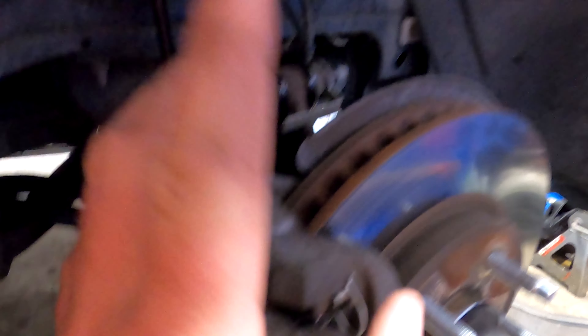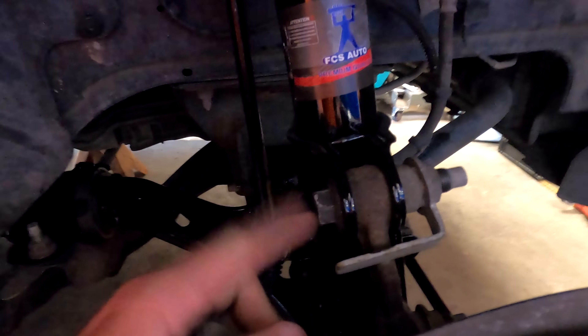Let's get these tires pulled off and get cracking — let's see how much we've got to pull apart. After one side is done, what we're probably going to do is remove the brake caliper, ABS line, brake rotor, and possibly undo these guys here and move the whole knuckle just to get it out of the way. Then we have to remove just three bolts — two right here, one back over there, and the ball joint bolt — so it shouldn't take long, it's just going to be time-consuming.